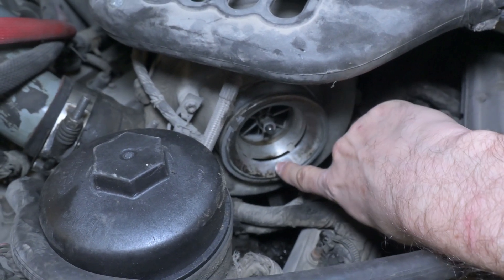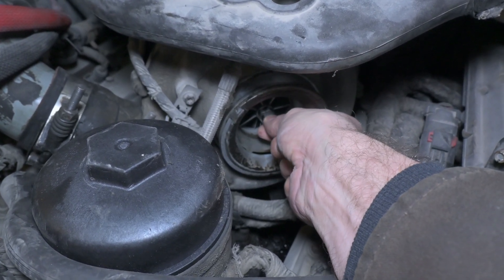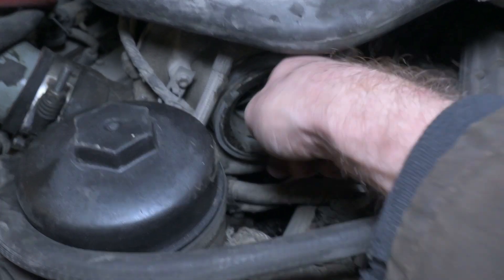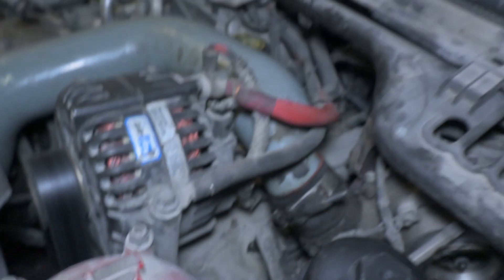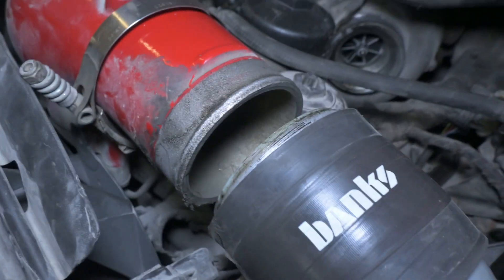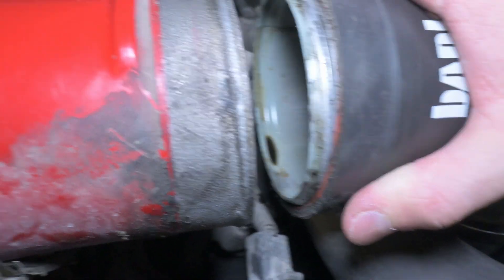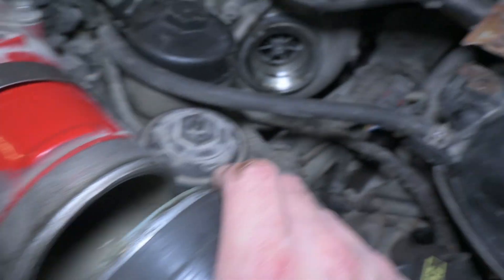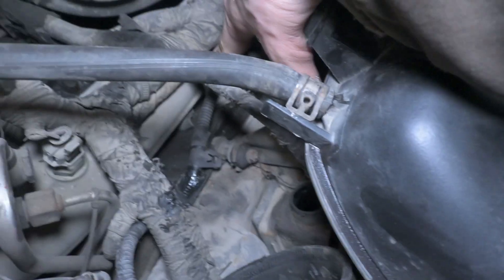You can see there's definitely some oil inside the turbo. There's a very small amount of play up and down, some more in and out — that's not great. Air intake from the turbocharged air goes through the intercooler and comes back up here right into the engine. There's definitely oil in there but it's not the worst I've ever seen. I'll let them know the turbo is probably going to need to be replaced soon.